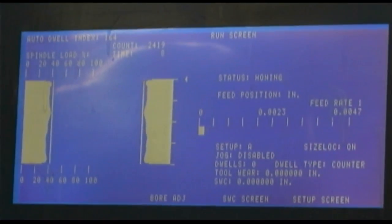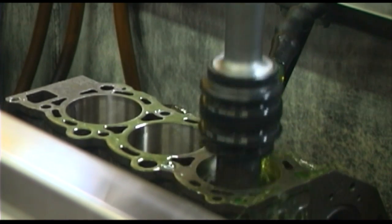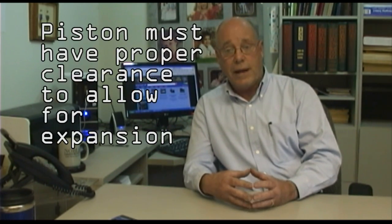The CK10 is also automated — it knows if the cylinder is round with the correct concentricity and it also knows that it is not bell-mouthed at the bottom. As you watch this machine operate, you will watch it take full strokes and then all of a sudden take little short strokes wherever it knows that cylinder isn't exactly the same as everything else. When this machine is finished, it automatically knows it has taken out the required amount. If we leave three thousandths to hone out, it knows we left three thousandths. If we leave two thousandths, it knows we left two thousandths. Most all pistons require two thousandths of an inch clearance.